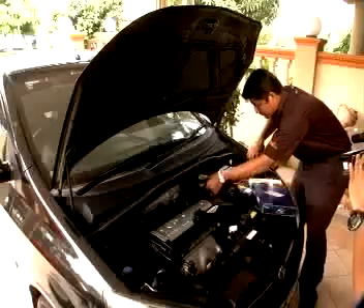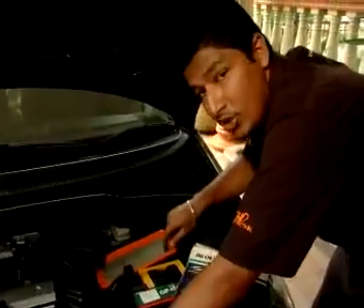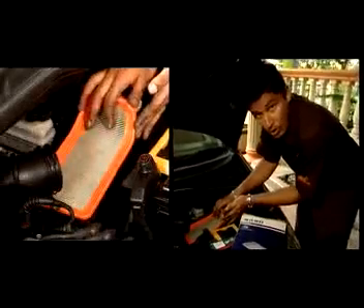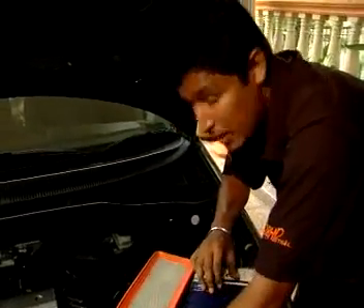The air filter is kept in the air filter housing and should be changed every 12 months or 20,000 kilometers. This is how it usually looks — a black plastic case with metal clips with a big black tube going into it. This is your old air filter. Pay attention to how it sits in the housing so that you'll know how to fit the new one in. It's interesting to find out what is clogging up your air filter and causing your engine to lose its power.